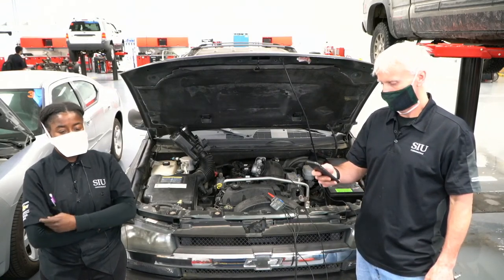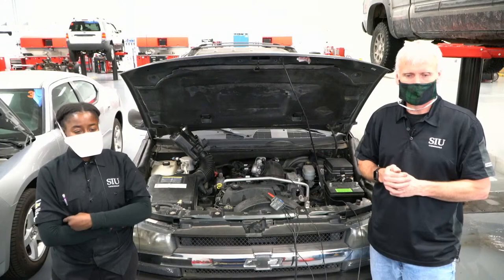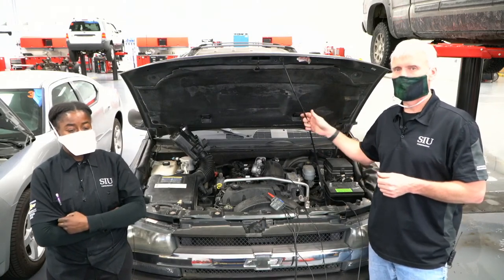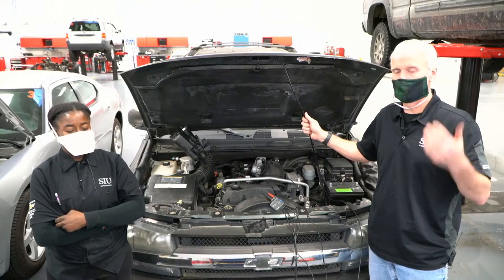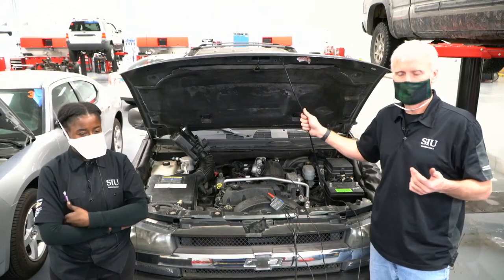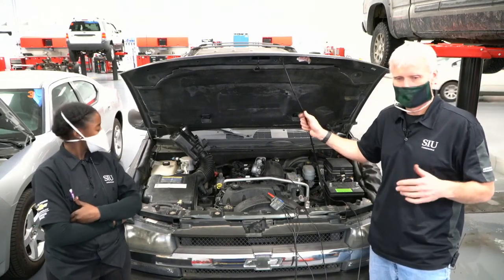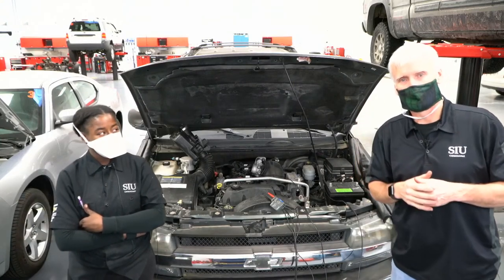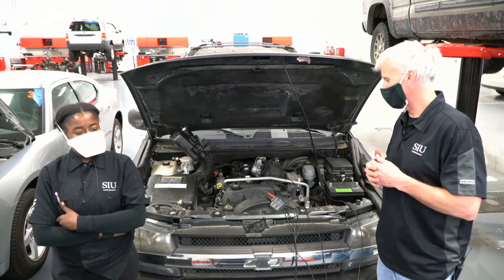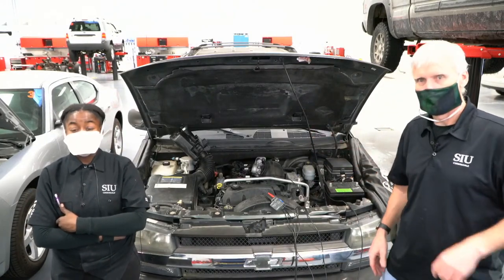Feel free to ask questions and I'll answer them when I get a chance online. That was it — pressure transducer diagnostics. Think about what this vehicle has for a problem: very strong vacuum, building no pressure, no compression on that cylinder — a dead hole. Cylinder four is horrible; cylinder two or three was great, giving us something to compare. The clue is negative 13 PSI on the intake stroke — 26 inches of vacuum — and no compression. That should be enough to figure out what it is. Thanks for watching, catch you on the next one.